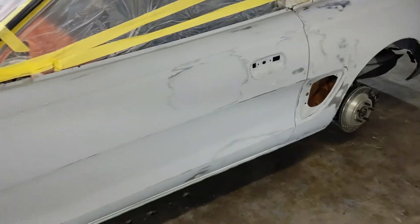So what are the takeaways? We're gonna fix it - we're gonna wet sand this thing and try again. Because now we can wet sand it without water soaking in and getting to the primer underneath, getting to the metal and rusting it out. So yeah, that's where we are.